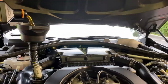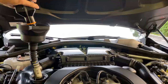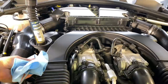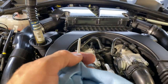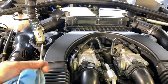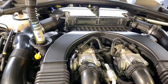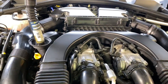Start filling the crankcase with six quarts of oil, then check the dipstick manually before adding more. I drained out a little over seven quarts — about 7.2 — which matches the owner's manual. This car thankfully has a real dipstick. After six quarts the level was at about 60% on the dipstick, so I topped it off with one more quart. Now we're at the top of the mark.